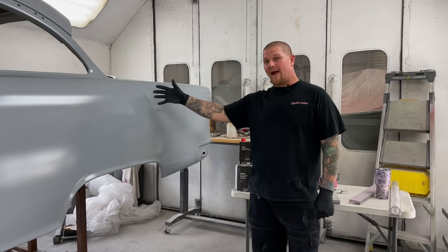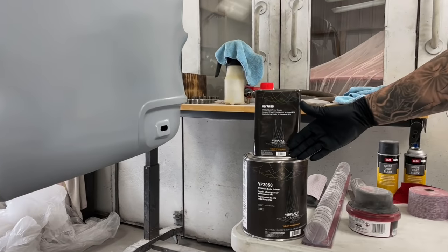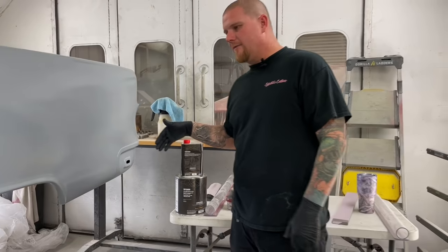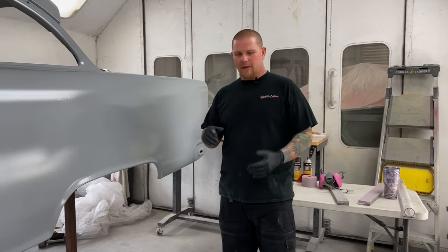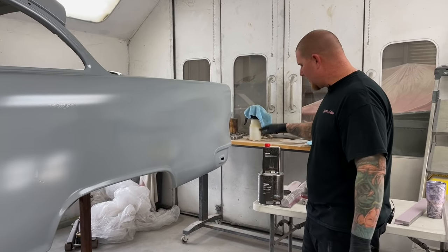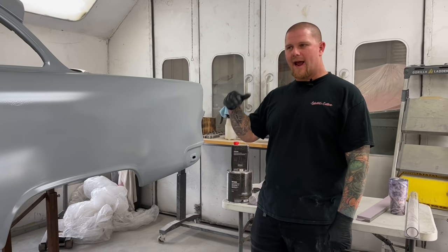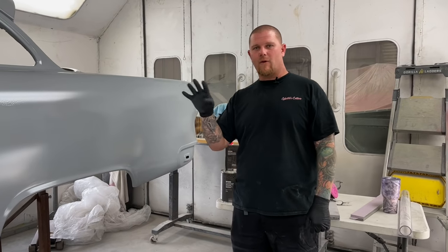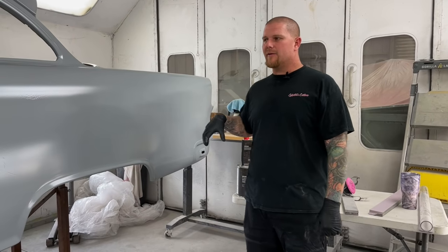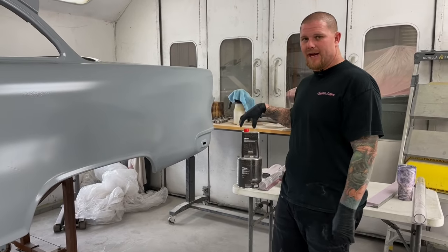So this is our first prime on the 55 after body filler work has been completed. We want to talk about the product that we like to use. VP 2050 from the Vibrance PPG line is a really good product, and here's why. Most shops will use polyesters after body filler and then have to go to urethanes and sealers. This is a one-stop shop product. Yes it is expensive, but when we are talking about how many products you're going to buy to put on the body filler after you're done with that stage, this is one. Instead of having four or five different materials that have an area to fail, this is one and it just eliminates that completely. If you have body filler that you've gone through and you have a couple areas of bare metal showing, this is covering all of those bases with one product.